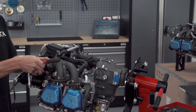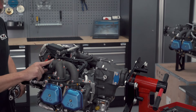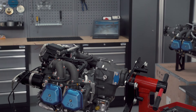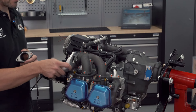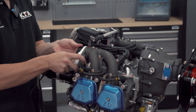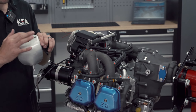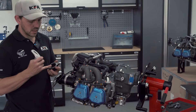One thing about the Zonshens is they don't have an O-ring that fits into the manifold here, so we're going to clean this surface and then put the drip tray on. The drip tray goes onto this face and sits on the inside. To make sure this side is sealed, we put a little bit of 577 across the face — and then we do the same thing on the other side.